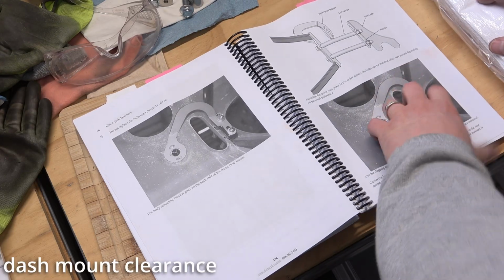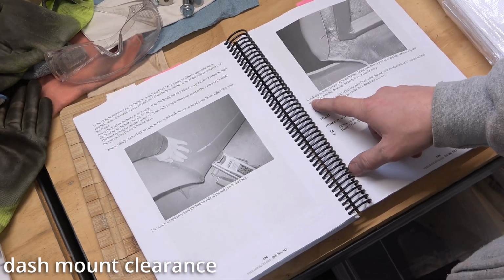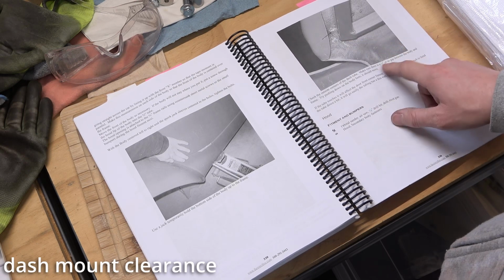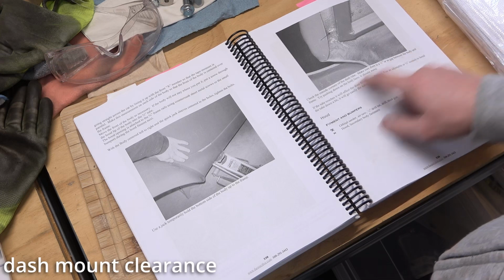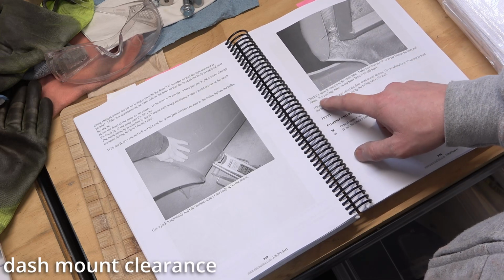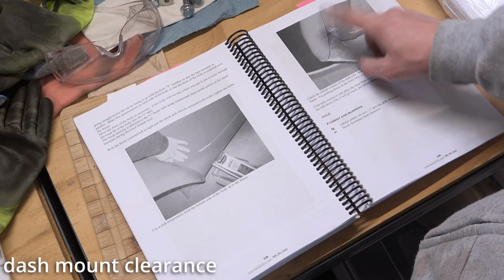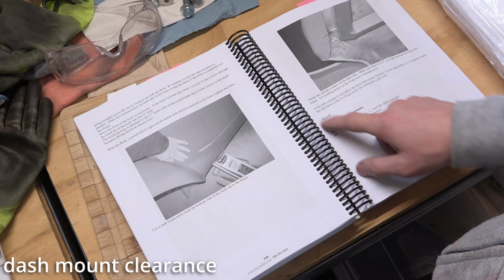Well, if we take a look at this manual, before you fit the hood, it says check the outside corners of the dash tube. Make sure there is a 1/2 or so gap between the body and frame. Try pushing down on the body here, it should move. And in fact, the body touches this dash mount frame for me.